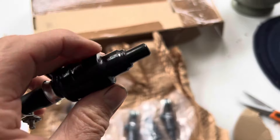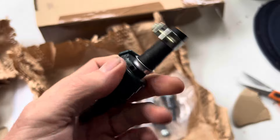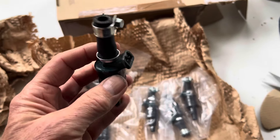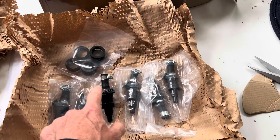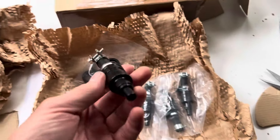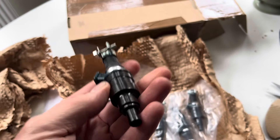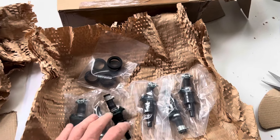The bottom seals here I have managed to buy the Mexican hat style of seal directly from Mercedes, so we asked them not to include these. But each one of these fuel injectors will have cost about £50 to refurbish, and what they do is they clean them, change the filters inside them, put on new hoses, new hose clamps, and paint them — all for £50. Now you could attempt to do this yourself and save yourself about £300, but unless you have the ability to properly flow test these injectors I would suggest spending the money and getting a professional to do it.